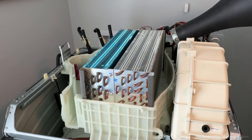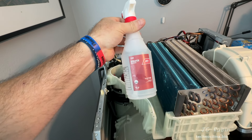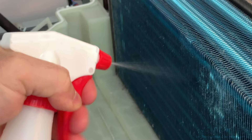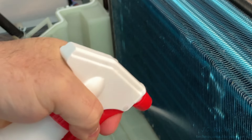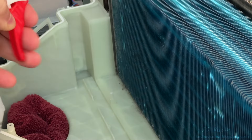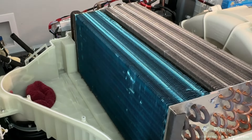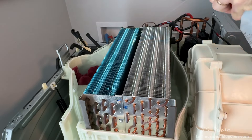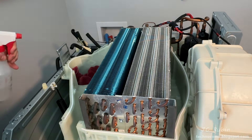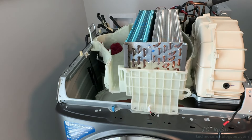The best tool would be a nozzle from a pressure-regulated air compressor, but I also found a leaf blower can be effective, as long as you don't touch any of the elements and always blow from right to left. I elected to use a spray bottle with demineralized water — not distilled water, but demineralized water — to spray down the elements to release the dust. A pressurized spray bottle would have done a better job. Because the water is demineralized, it reduces the chance of scale forming on metal parts. Distilled water could react with metal or coating surfaces, so avoid it. The water washes small particles of dust down to the bottom pan where dirty water can be wiped away with a towel.